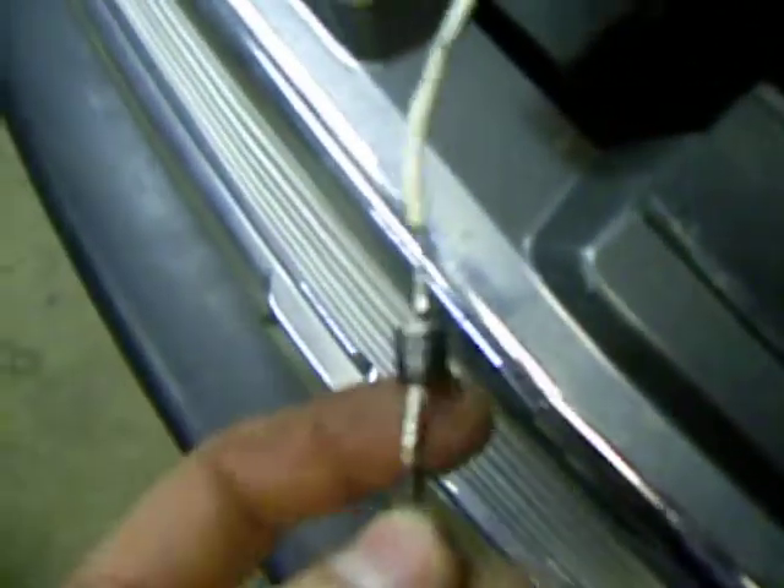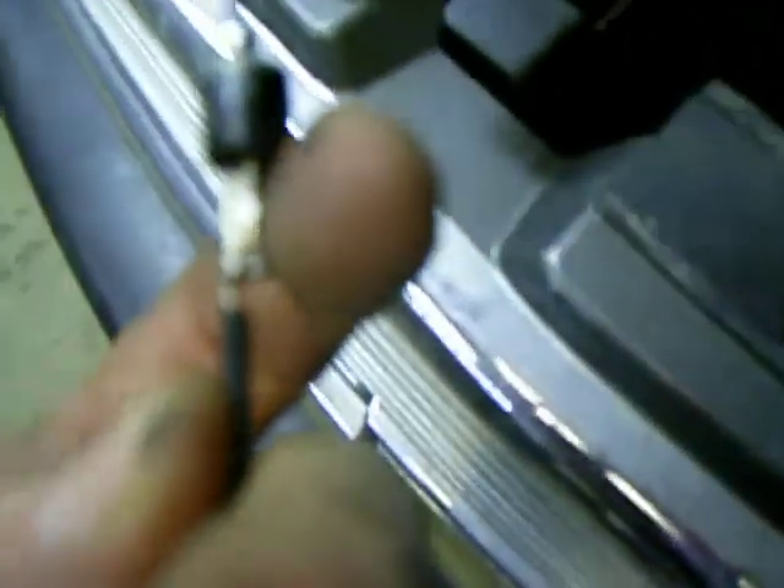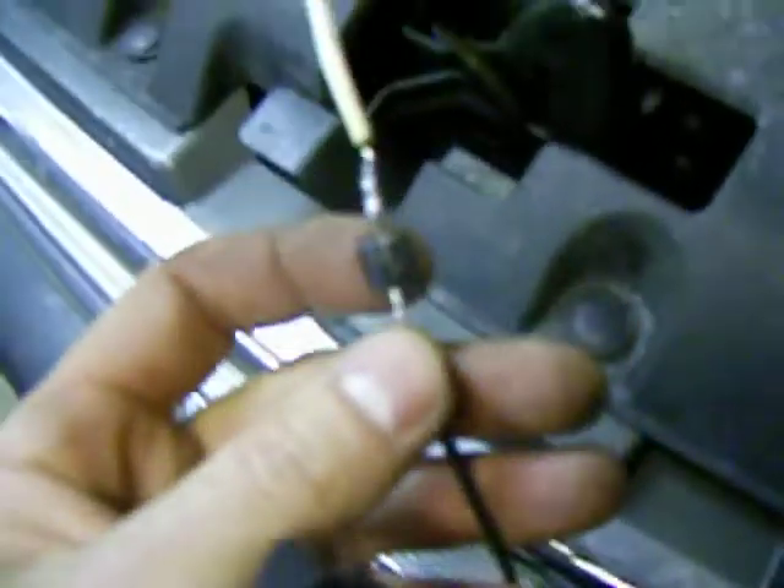When I removed the pulse board, I could see a diode — a big, fat diode — lying right on top of the gear of the wiper motor, right there in the center. My diode was sitting there. I'm going to show it to you in better lighting. Here's the actual diode, and it's a big one — way bigger than normal. The rating on it is 10A04, and underneath that it says MIC. I assume that's 10 amps maximum rating, though it could be 4 amps. Anyway, that diode was lying on my gears.